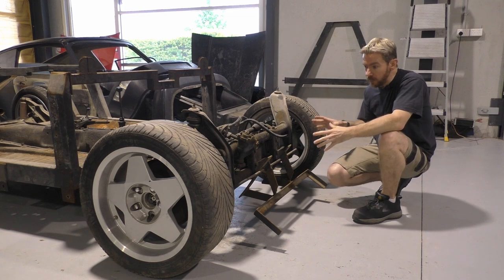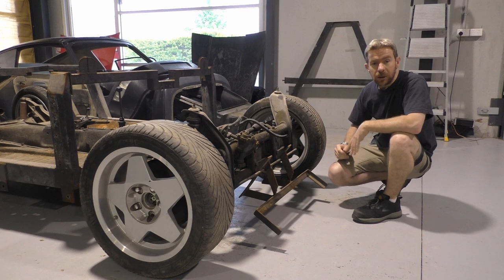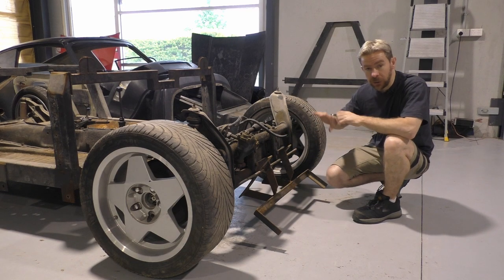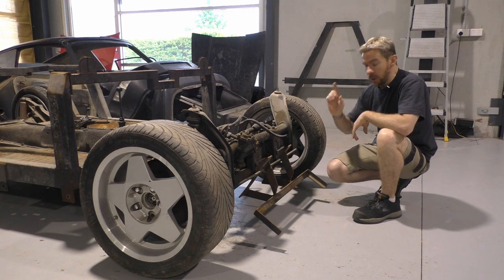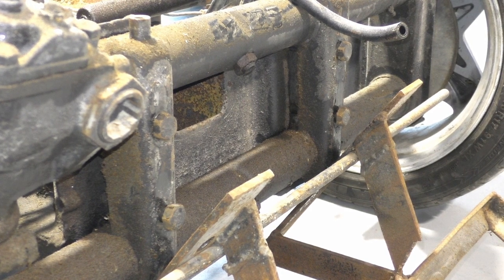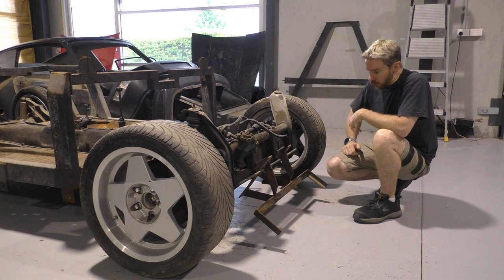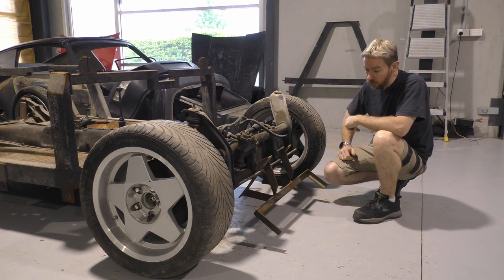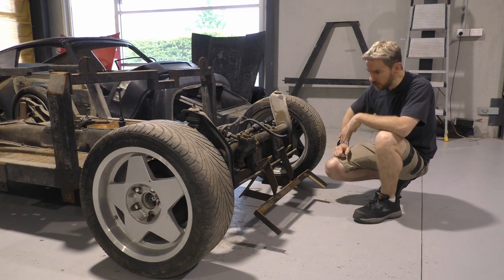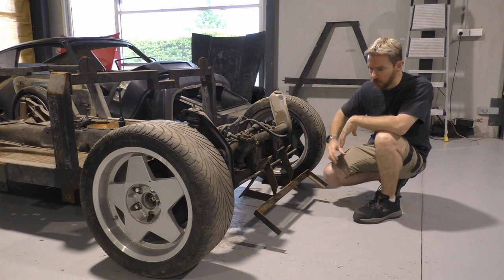The front end — with the tub off, I can now see everything underneath here. These four bolts are the only thing that secures this entire section to the rest of the chassis. There is one bolt which has given me a bit of a headache, which is of course allowing the entire thing to flex and not have the right side of the vehicle true. This will need to come off anyway, and then I'll find out why the bolts aren't sitting properly. I may have to replace one, maybe re-thread one. Everything seems to be in order — there's no twists, no breaks, no cracks. It is simply just not sitting properly because of that bolt.